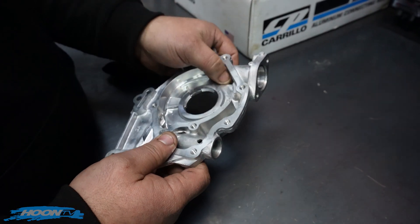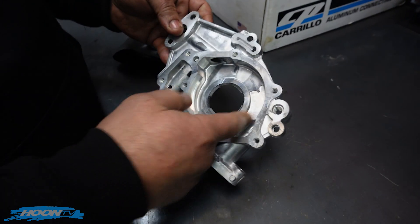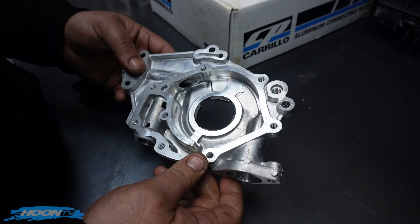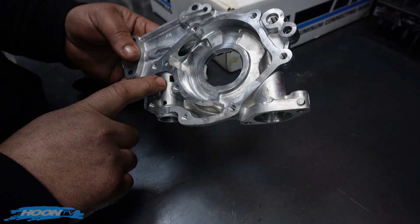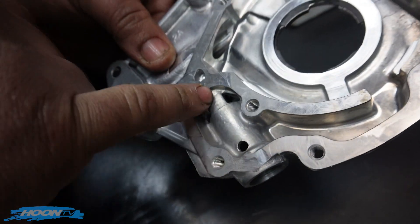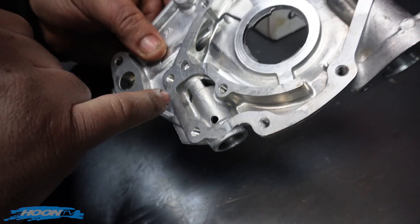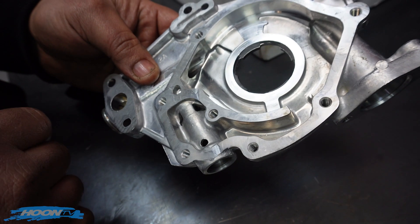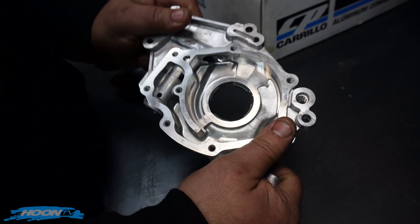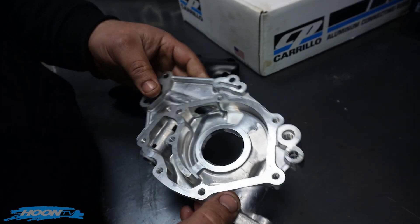You really don't want to make that wall too thin, and a lot of people have seen videos online of pump housings splitting there. The other thing is people jump in and modify the bypass section as well. We don't do that, purely because the wall section that guides the little check valve running up and down is only a quarter on each side. Once you start modifying too much, the little check valve can twist, and once it twists and jams in there with the housing flex, you'll have your check valve remaining open and you'll lose all oil pressure entirely.